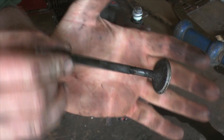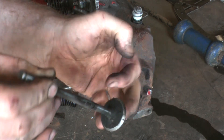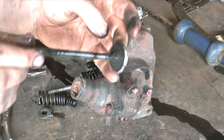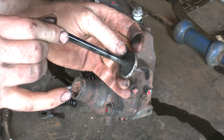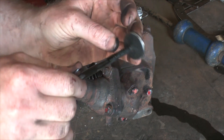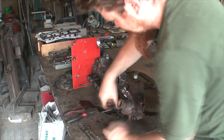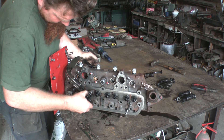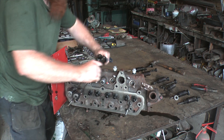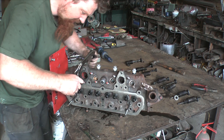This is an exhaust valve, and it's kind of what you'd expect — it's very coky. It's a soft build-up there; it's not baked-on carbon. It's so soft I can get right through to the metal. That's because it's been running at tick-over most of its life. When I've done this on motorbikes, for instance, this black here is rock hard — it's literally baked-on carbon and it takes a lot of effort to get it off. But this is just coming off from a nail. It's hard to imagine doing this without the right tool.